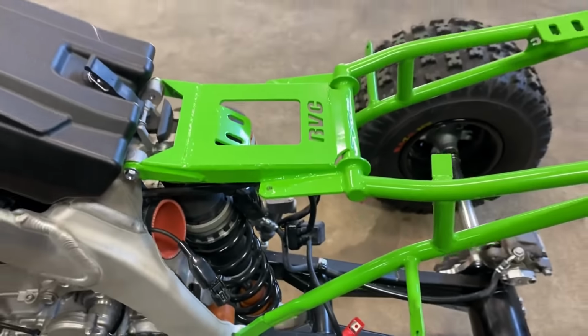So our goal with this 2019 and up Kawasaki kit was to just be as absolutely clean as possible. There's minimal trimming on the fenders, so all we did was remove the back section and that was completely it. So factory mounting locations there. We're actually supplying the grommets, the bushings and everything in the seat bracket here for your seat and your plastic mounts in the back. And we relocated the fender mounts up high, up here. We did that so if you ever run something over, you're not gonna actually bend the bracket. So that's about up here now and it's farther in. So we're just gonna pop some holes there, or we're gonna trim this off to clean it up.